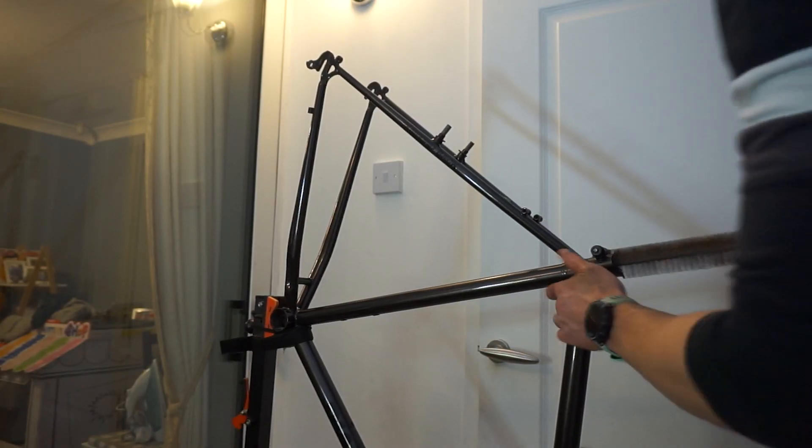Let me show you the situation now, having cleaned and filed and got this into a state that I think the HypeRite is going to work. This is how freely and smoothly the seat post is moving up and down inside the seat tube — this is with no grease. I think that's pretty good. The only sticking point, literally, is about there — my files wouldn't go into the seat tube far enough so it does stick.